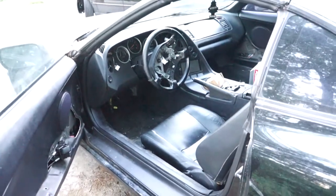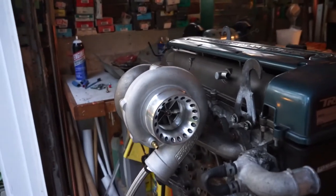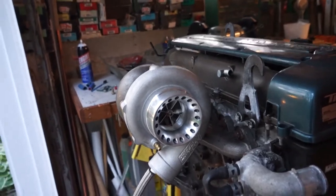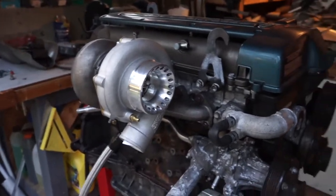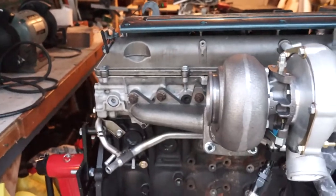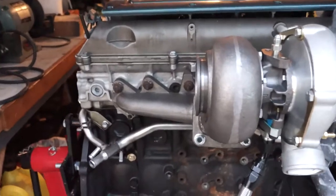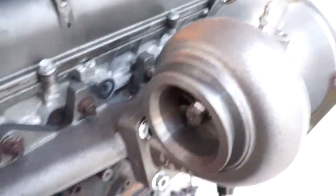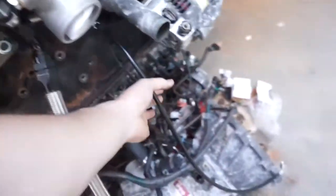Here is the engine. I'm sure you guys noticed in the trailer I showed the precision turbo on the engine. In my last update video, this was all just nothing here — I ripped off my stock twin turbos and also ripped off a couple more things like the oil lines. I put on a Powerhouse Racing street torque turbo kit. It's not completely done yet, but this is pretty much the manifold with a Precision 62-66 turbo, with the high pressure feed and drain kit.